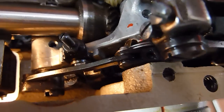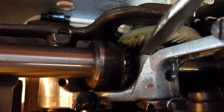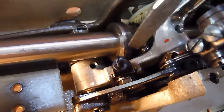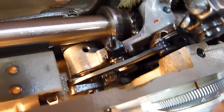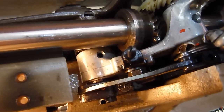To make this repair you have to remove this silver foot. To do that, release the snap ring here, remove the set screw here, and then very carefully — without damaging this nylon gear — drive out the pin from the inside towards the outside of the machine. You'll then be able to remove this assembly. Once it's out, you can get to the pin, physically remove it, clean it with carburetor cleaner and a rag or paper towel, and then reassemble it.